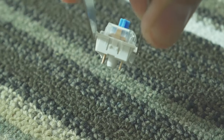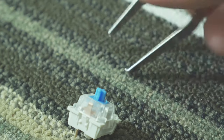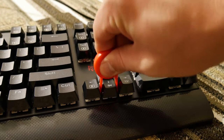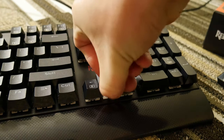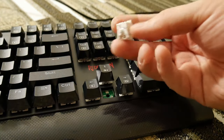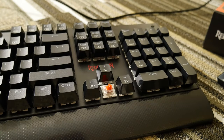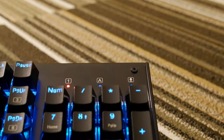This is just something you don't see in a keyboard at this price — the ability to take out the switch and change them. If you decide to go with different switches in the future, simply take the keycap off, use the switch removal tool to carefully remove it. Be very careful not to bend any of the prongs or damage the PCB. Make sure you line it up so you're not bending the prong on the bottom, and you're good to go — you've inserted a new switch.